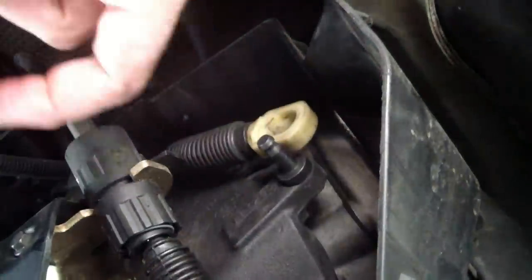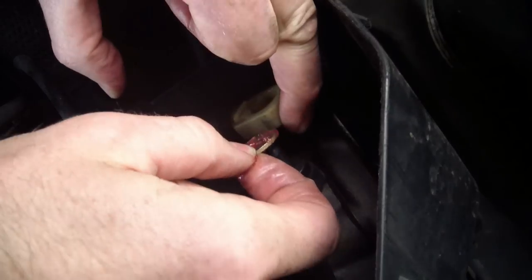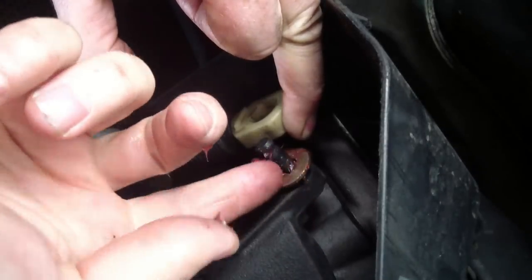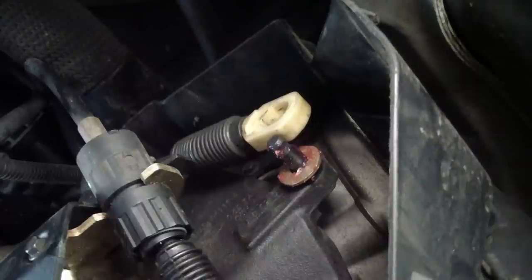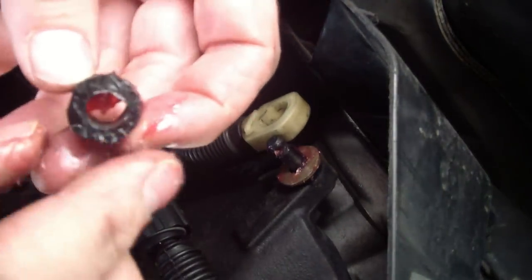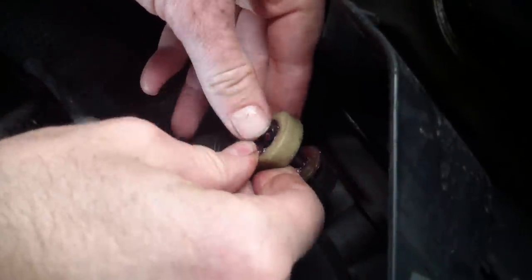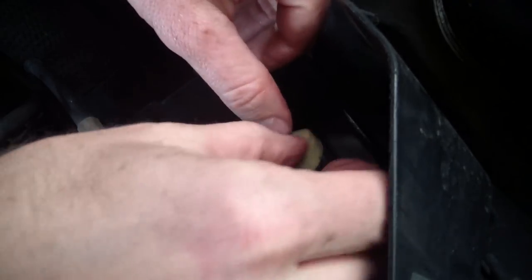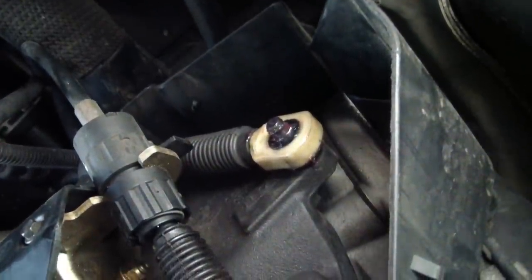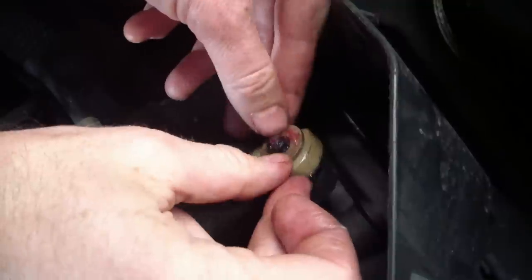Let's see how this goes. This transmission area is inside a little plastic case so there won't be much road crud getting in over time, which is good. I've got one greasy washer — putting grease on the washer, a little grease on the shifter shaft, and grease all over the rubber washer to make it slippery. Pulling it back down and getting it over here with a lot of grease packed into it. Then sticking the final hardened washer over the edge. That feels real good, just the way it fits on there, nice and tight.